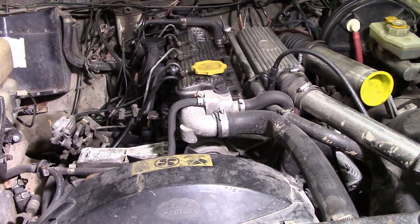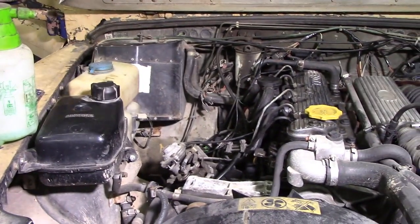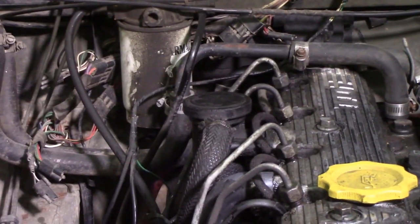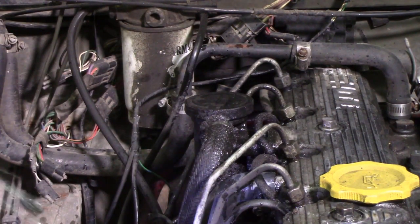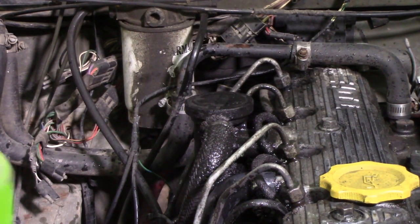I should really put a plug on like I put here on the manifold itself, but it's too long. I just wanted to show you that this leak here has stopped - let's wait a minute, let's zoom in. There's not any smoke coming out. Let's put some soapy water around and see if we've got a leak there - nothing. But I want to show you something else.